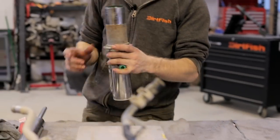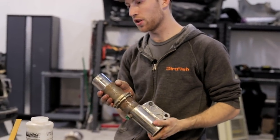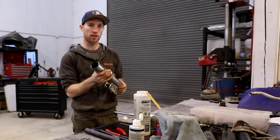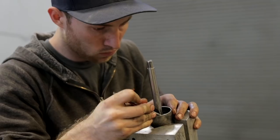So this is the biggest maintenance portion of these shocks. This grease should be changed about every other rally. At the school here, we run about 60 hours on the car before we take this apart and check the grease and replace it and that kind of stuff.